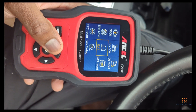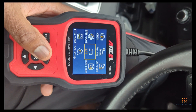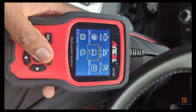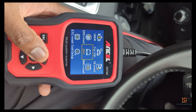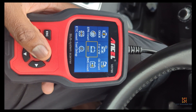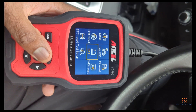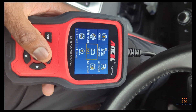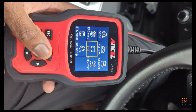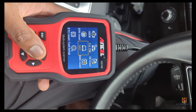As you might know with these cars, especially the modern German cars — Mercedes, VW, Audi, BMW — you don't just go to a shop, get a battery, and change it. There is a procedure that you follow in which you're supposed to register the battery you're replacing. The reason why is because these battery monitoring systems in these cars do charge regulation.